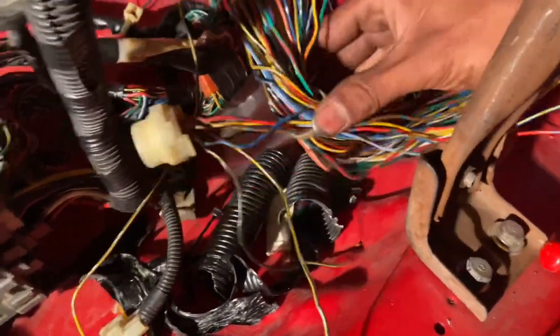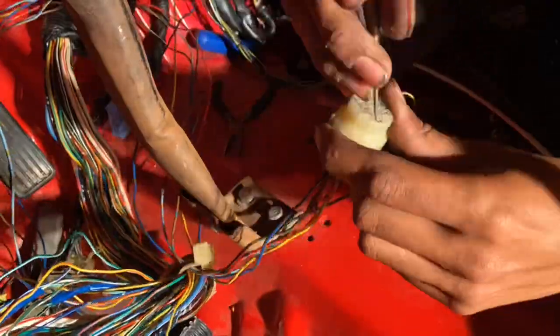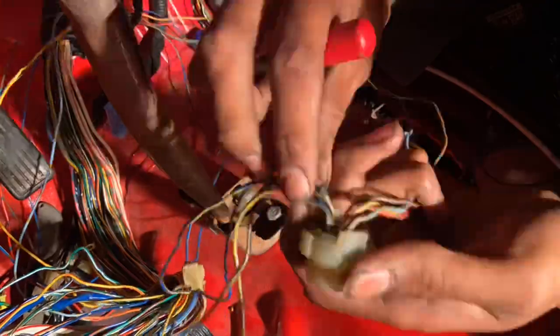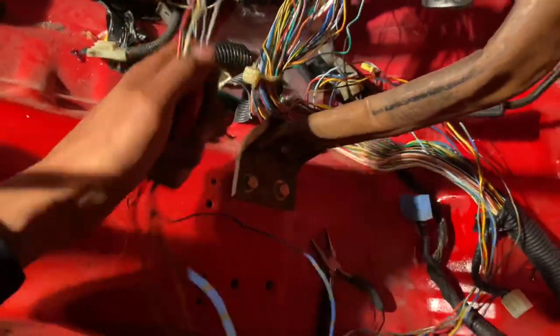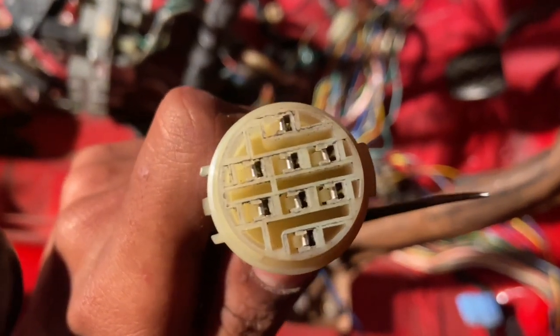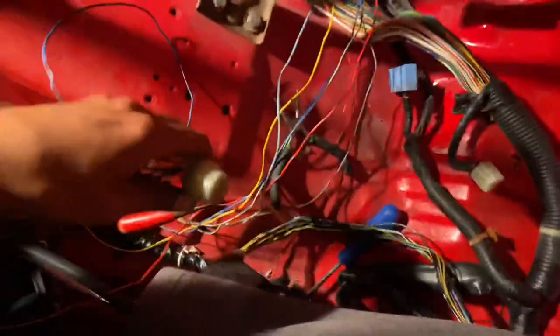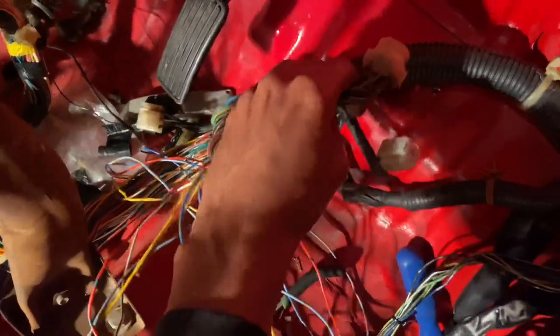I'm trying to keep all of these little zip tie plugs intact because I want to reuse them, but we have a plug on this side of it - so how are we going to get this plug on the other side? I de-pinned and re-pinned every single wire. I didn't beat them up because I have a new de-pinning tool I found in my late uncle's garage. At this point we have way more than enough wire to actually reach our connector. I'm going to re-loom everything up to here and then make this branch off as a little tiny sub-harness connector.